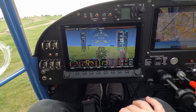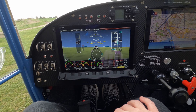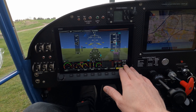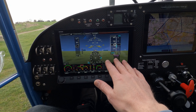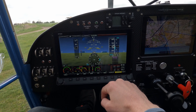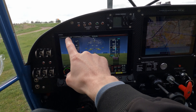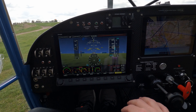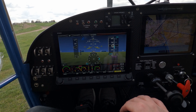The Dynon system is quite sophisticated in terms of what it's capable of. I have my engine information on the lower portion of the screen — the EFIS — and above that the artificial horizon, altitude, airspeed, true airspeed, ground speed, density altitude, and outside air temperature. The top row is currently covered with Xs, but with the integrated Dynon transponder you can press any part of the screen to customize or change the information displayed on those screens. You can also see me operating the autopilot in my last video.